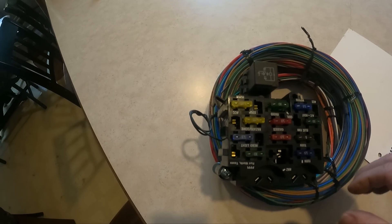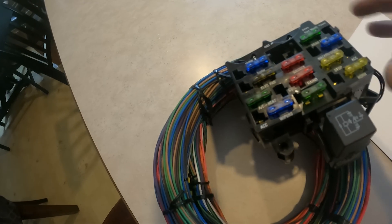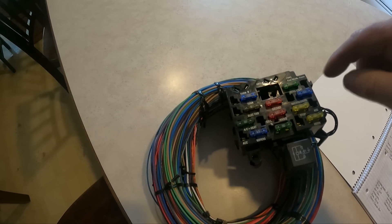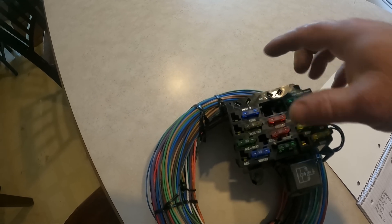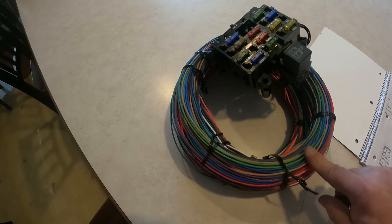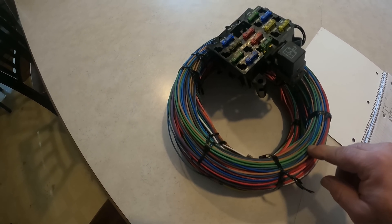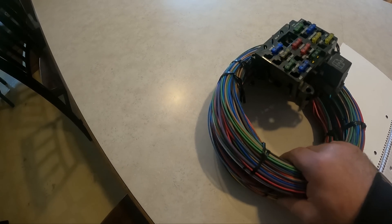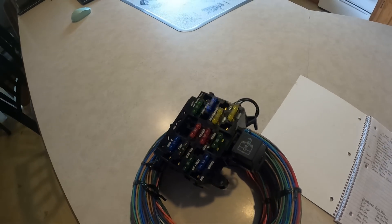Here's the harness that Paul brought me. This one is from Painless — it's got 11 fuses, a horn relay, a spot for the hazard flasher and the turn signal flasher. Pretty standard stuff. The wire that they send on these Painless harnesses is really pretty good. It looks like GXL — polyethylene insulation — so it'll take some temperature. This is OE quality stuff. Nobody sponsors me on any of this, so keep that in mind as I talk about all these different brands. This is all from my personal experience; nobody's paying me to do any of this.